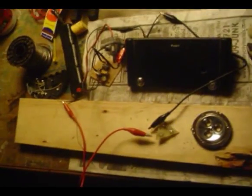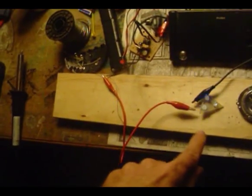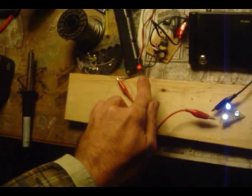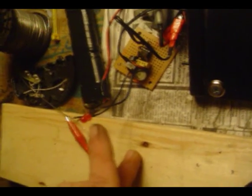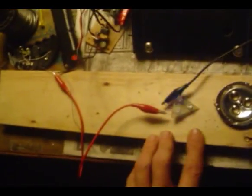I ran into a problem. I had it all mounted in the dash, and this is my little dashboard blinking light — it must have had less resistance than the blinker lights, because when I hooked these up running in parallel, these wouldn't blink at all. This one had less resistance and was just stealing all the energy, so to speak. I had to put in a little variable resistor on this light so I could dial in the red one's brightness and give more resistance so the blinkers could actually blink. Now I think I can mount it all back in the dash again.